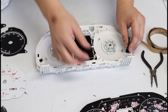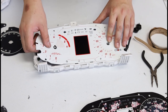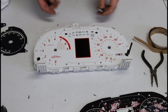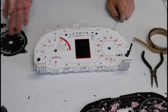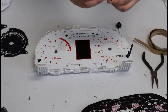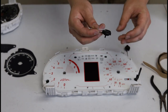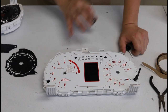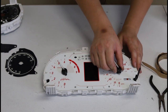Pull it up and out. Take your new gauge face, put it in — we have these little guide holes like OEM — flip it in like so and make sure it sits under. If you do have a white gauge face, use gloves. As a side note, if you want to change your needle color, you can paint them red — you can get red needles from Value Art Gauges, or scrape the existing paint off and apply nail polish. There are plenty of tutorials on this, and we may do a video, but not today. So now you're going to put the needle back in.